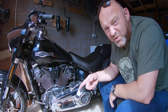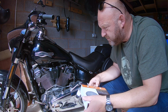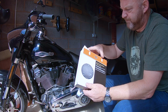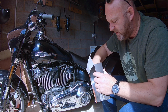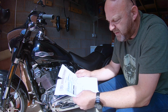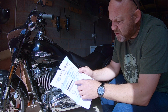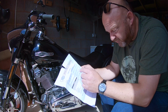So what you need to do is get your new Derby cover out. Let me do that, the box. Look, there we go. So possibly the worst time to be making a video. There's my Derby cover there. Let's just get this out of the box. Open it up properly. There we go. It's got a set of instructions as well, the Derby cover kit. It shows you how to put the screws back in, and it also shows you about the torque settings here. The torque settings are 2.8 to 3.9, or 25 to 35 inch-pounds, and it also tells you to add a bit of thread lock as well.